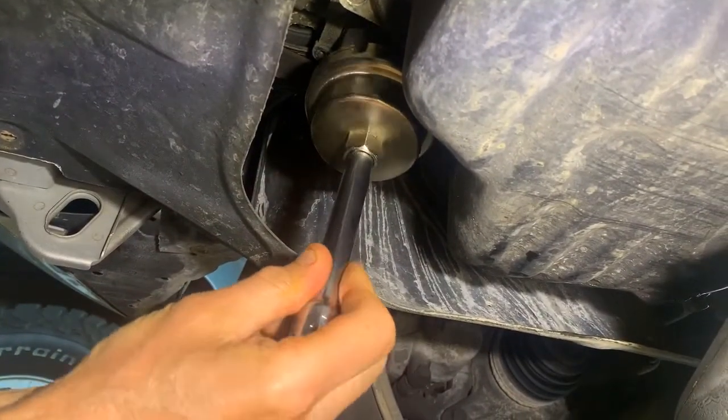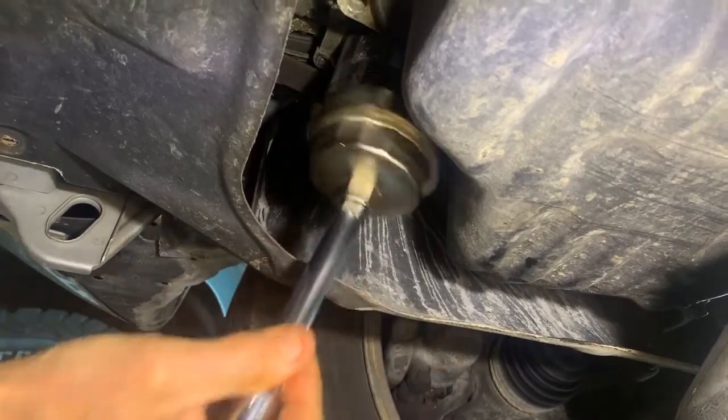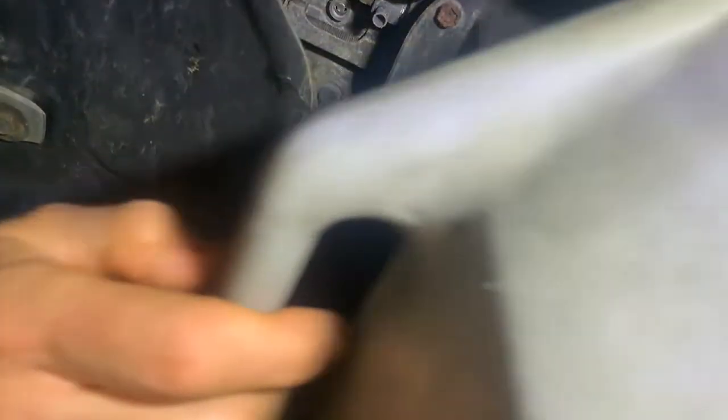I had to get two hands on it, but now I've got it loose. I'll get the drain pan underneath and spin it off the rest of the way. You want to make sure the gasket came off with the oil filter and didn't stick to the engine surface, because if you put the new one on over a stuck gasket you could double-gasket it and create a leak. The gasket stayed with the filter, so I'll wipe the surface off and put the new filter on.